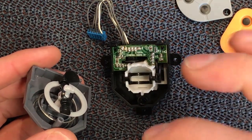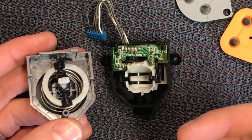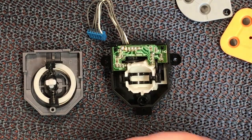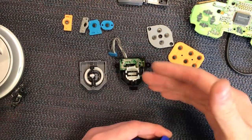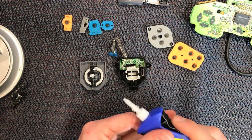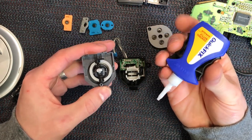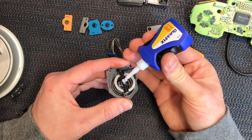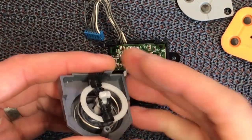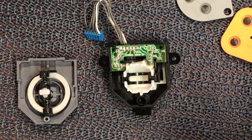I think it's easier to put a bit of glue on the end of the joystick — just a little bit — to extend the length just to give it a little more pressure to make up for all that plastic that has been worn away. You could also put super glue into the bowl, but I find that more difficult because it's hard to get a nice smooth surface. I'd recommend using Selleys super glue with the squeeze triggers on the side so you can really control what you're doing. Very gently put a tiny drop on top — there's now a small round blob of super glue on top.